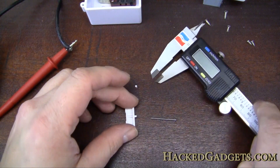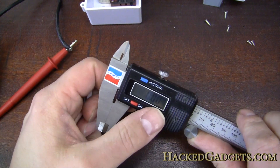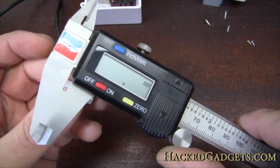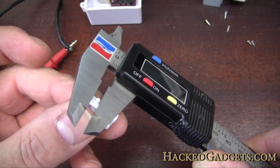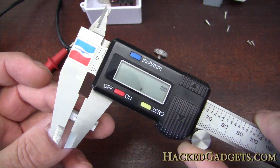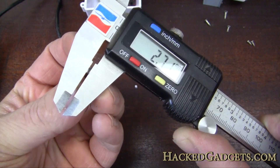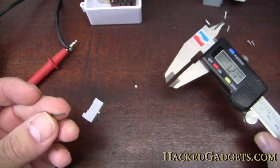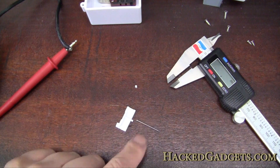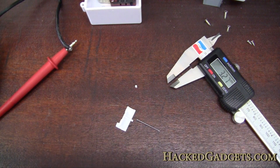Since this is such a trivial failure and has nothing to do with the actual electrical portion, I'll repair it. If it was something electrical I wouldn't modify it because that could be dangerous. This little tab measured 1.85 mm. I have a finishing nail that's about 1.35 mm - fairly close, just a little bit smaller. I'm going to modify this so that the pivot point is now metal and it'll be on both sides again. Should take about a minute and a half.